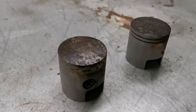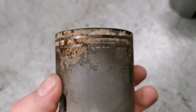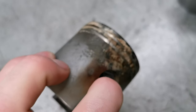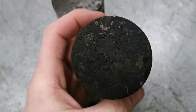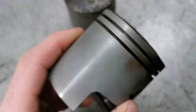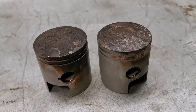We tried that for a couple weeks — it didn't work. We ended up taking the engine apart, and as you can see here, here's the mag and PTO piston, and you can see the corrosion, the ring stuck. It took the boys quite a bit of work just to get it apart and get these off the crankshaft and out of the cylinder. Then the next step was to say, okay, are we going to try to recondition these pistons? Are we going to try to reuse them? Can we pull the rings off and clean them up? We probably could with a bit of work — we'd have to be really careful with those ring lands, cleaning all the carbon deposits and the crud out of there.